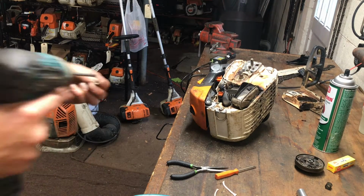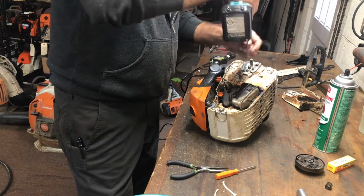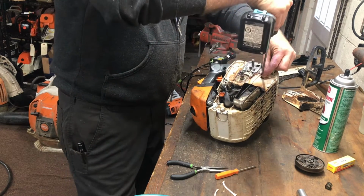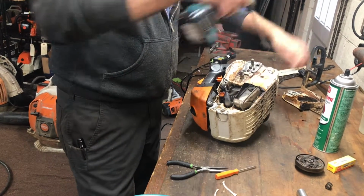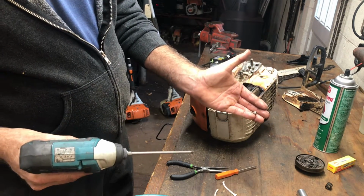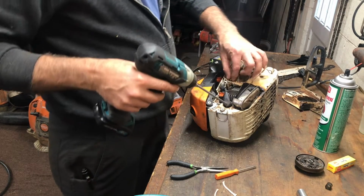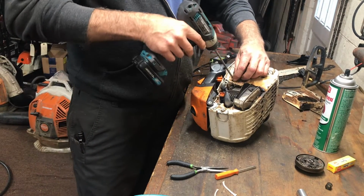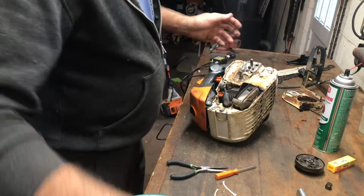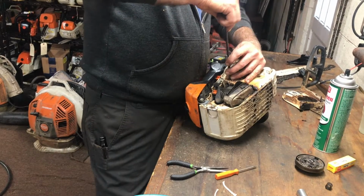Yeah, there we go. Roll these back in, and again, just nice and easy. Especially, these are the shorter M4 screws, so you have less thread contact, which means you can't put as much torque on here as you want to. Just snug and a little bit.